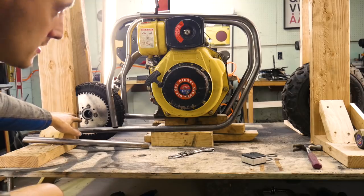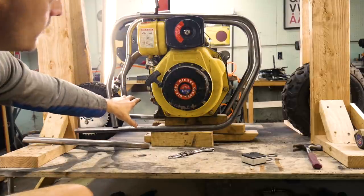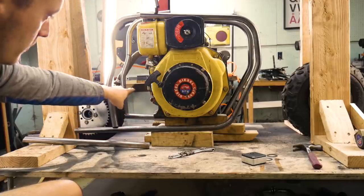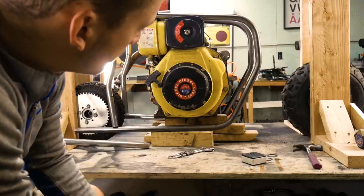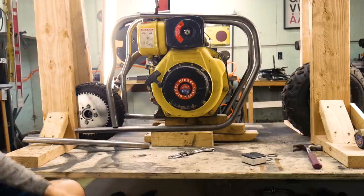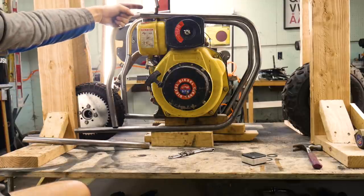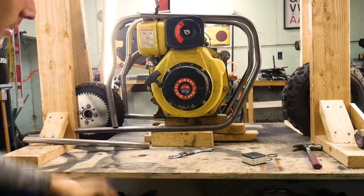I think this is gonna be the baseline look of the frame. We got enough room for the jack shaft and the other side of the torque converter over here. I meant to make some room for the battery right here, but that might still be too small, so I might have to end up putting the battery somewhere else. I think the next thing to do is shorten these pieces right here so I can weld them to the longer tubing, then notch this out and weld everything together.